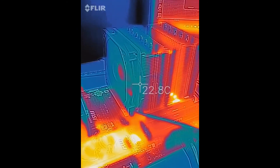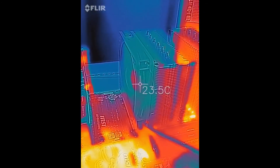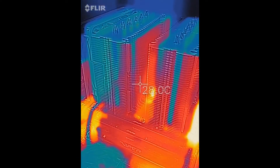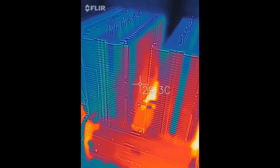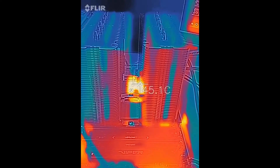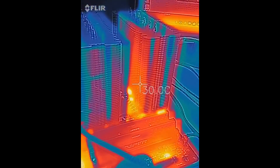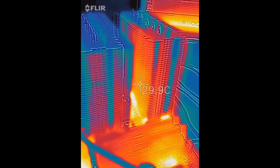So let's get some temperature readings. The setup here is using the Noctua D14 with the stock fan — just a single 120 mm fan — with a mild overclock to generate a little bit of heat. Looking at the inside of the fin stack, we're right around 29, close to 30 degrees C. The center area is the VRM on the other side of the motherboard, so that's going to be a hot spot to avoid. The other side of the fin stack is also right around close to 30 degrees C.